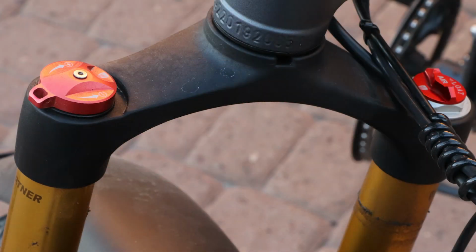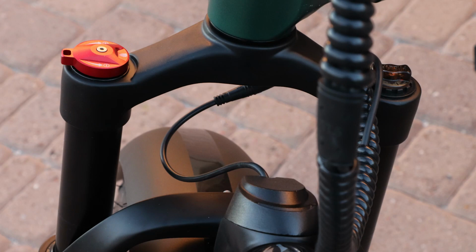It also eliminates the cluttered look other e-bikes have when they scatter battery and other components as attachments to the frame. They've changed the front forks from air suspension to coil suspension. This simplifies maintenance and eliminates the need for a special pump to maintain air pressure. The preload can now just be dialed in rather than requiring air pressure adjustments.